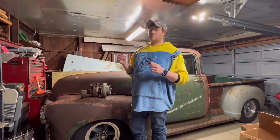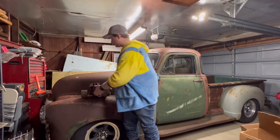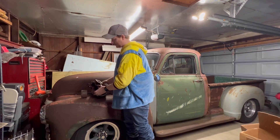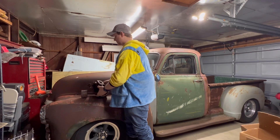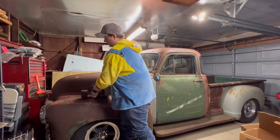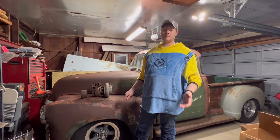And that goes back to the same thing — if you buy a knockoff HX40, a lot of times the exhaust flange bolt pattern is not the same as genuine. You end up with a lot of issues with downpipe adapters not fitting and wastegates not fitting. It just typically ends up being a bigger thorn in your side than a bonus.